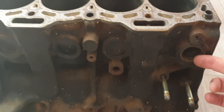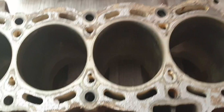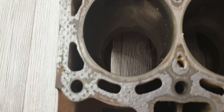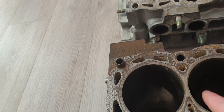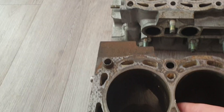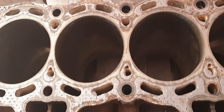If I can quickly show you, the actual water pump sits around about here and there's a hole that goes in and it goes straight through the jacket — straight through into these jackets around the engine. These are all connected and they all circulate. One thing you might find kind of interesting is between the Siamese bores here you'll notice a gallery going in over there, and then there's a gallery running that way. That basically connects this side up to this side but it comes across where the bores meet and cools the cylinders where the water jackets couldn't normally touch — so there is an important little feature to the block.